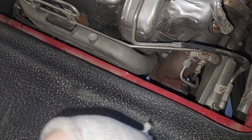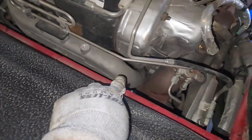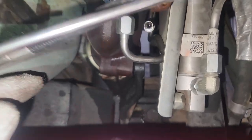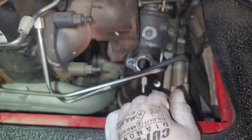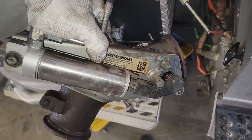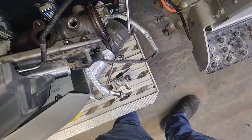This is your intake from the EGR to your intake, and that needs to be pulled off if we're going to try and pressurize this thing to check the EGR cooler. However, you can't really get to the bottom bolts without pulling the exhaust brake and also the downpipe for the turbo, which is almost as big as the hole for the doghouse. It also has a fuel injector for the regen system I had to pull off, and coolant that goes to it so I had to drain that. That tube — the exhaust manifold to the rear of the EGR cooler — look at how big this thing is. That is ridiculous! Trying to get it out of there was like some industrial Tetris.